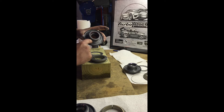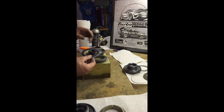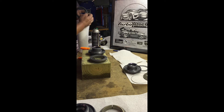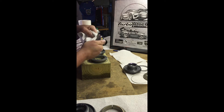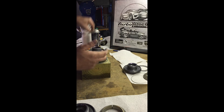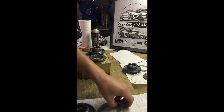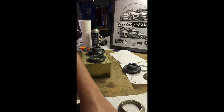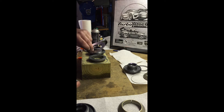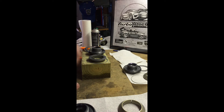This is what you're trying to clean out — all of the stuff that's in there. You're basically repacking this thing. You've got to start by cleaning it up; it's probably one of the dirtier jobs you'll ever do with wheels. I like to wipe off the heavy grease with a paper towel so I don't get it all in my parts washer. Keep wiping all these down and when you're done they end up looking like this — a nice clean one, a nice clean friction disk, and the same for your little c-clip.